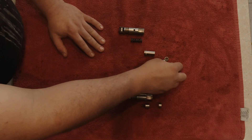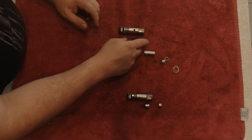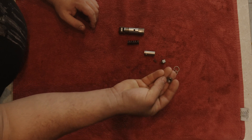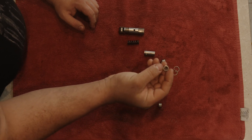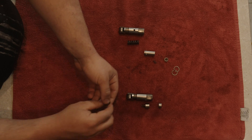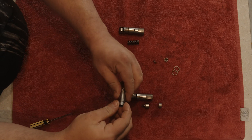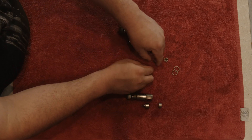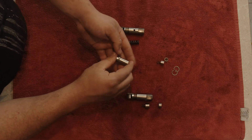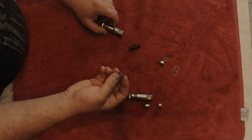When we take a look at the MDS lifter, you can instantly see we've got two circlips that hold in this entire assembly — and no doubt it's because when we get to these springs, we'll see why. Once again we have a cup, although this cup is a different shape — that's our receiver for our push rod. We have the same section, although when sat side by side you can see it's much smaller, because it has to slip into the barrel of this component. Again we have our spring, so when we're setting our preload we're setting it exactly the same. However, these push pins are what your MDS system is activating.